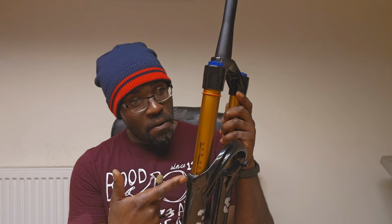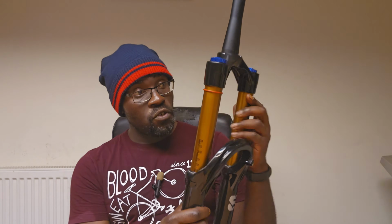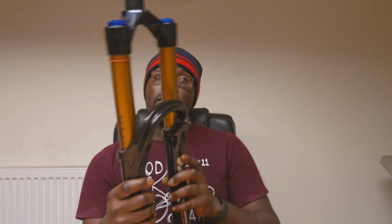But that's pretty interesting. I was not expecting that. If you can change it between 140 to 180, considering that Bucklos don't declare that, that's interesting. Okay, all right. They say the steerer is supposed to be 220. Don't have my actual tape measure, but I've got a ruler, so I'll just quickly measure. 220. That's correct.